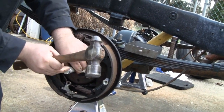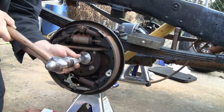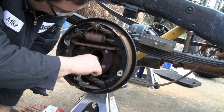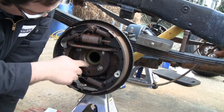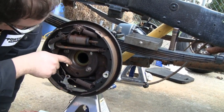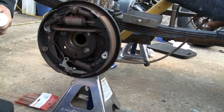Checked the manual — it says send it home, all the way. Some seals you just make flush, but you do exactly what the manual says. There you go, sounds solid. Feels about the same depth. If we were really precise I could get a depth mic and check that, but I got a trained eye here. You can see we sheared some of that sealant — the rubber stuff — and that's gonna stay in there. Great job.